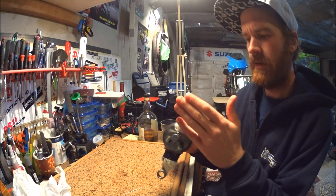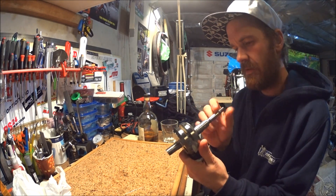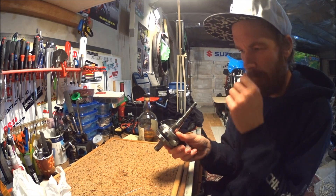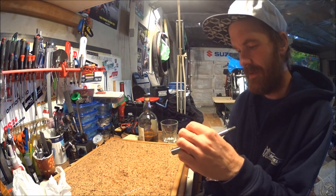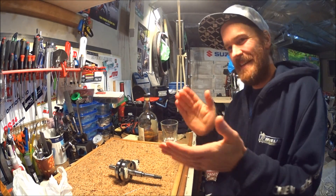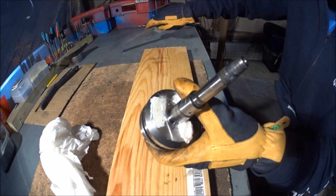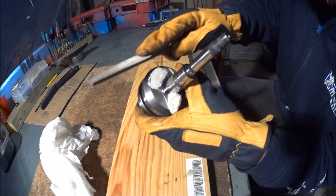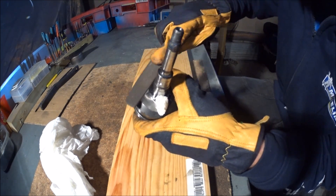Now I just need to grind down the excess, and then we can start the assembly and check the balance factor. So grind it down, recheck the balance factor to see where I managed to get it — hopefully around 60%. Then rebuild. I'll bring you over to my grinding station. Actually, I think I will just finish this up with hand files. I'll take it along a little bit of the way and then just finish it off camera, because it's not that interesting to watch someone file epoxy.